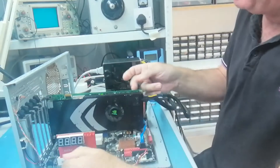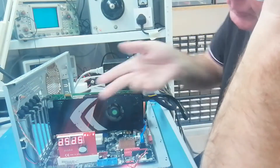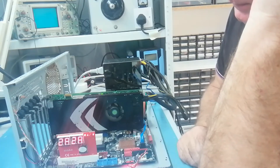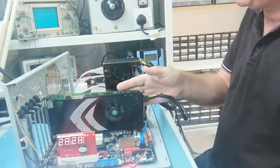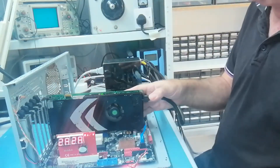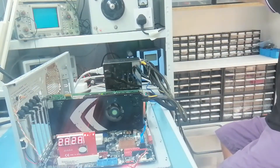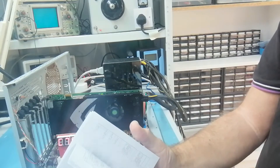I noticed there is actually a little buzzer on the top of these cards — I'm sure that's what was making the noise. Let's give that another go. Okay it stopped on 2A. We'll see if that means anything — quite often these POST analyzers give you a code, but the code doesn't tell you a lot. Let's look up 2A.